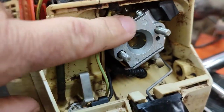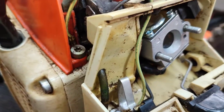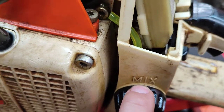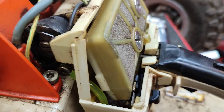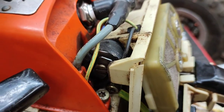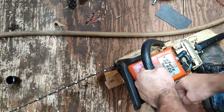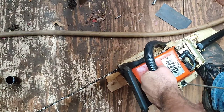Let's put the new cover on. I've got to put a new plug in, put some new fuel in it, and we'll see what happens. Alright, we're back together. Got new fuel in here. I also put a new breather line for the tank. Choke is on, I'm going to give it a couple of pulls and see what happens. I'm going to prime the new carburetor.